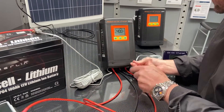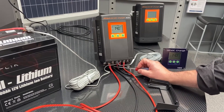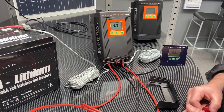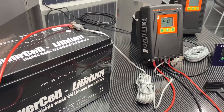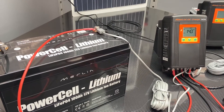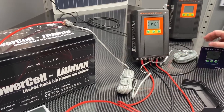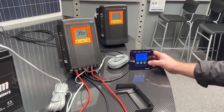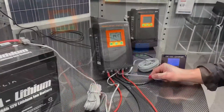Looking at the connections inside the unit — I'll just take the front cover off — you can see within that we've got a positive input from the engine battery, a negative from the chassis, and then we've got the positive out to the auxiliary battery. You'll also notice there are a couple of extra wires connected here. The first is a temperature sensor, fitted to the top of the lithium battery. We would always recommend temperature-compensated charging for lithiums, especially in vehicles, and especially where they might be in the back of the vehicle where it can get very, very hot in the summer. The other wire connected here is for the optional remote panel, which will allow you to monitor and set up the DC-DC charger. This is more really suitable for boat use — people would like to see that on their chart table. On a vehicle, generally people want a fully automatic system.